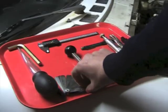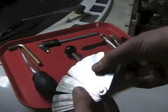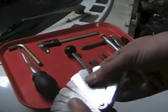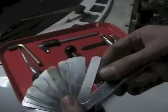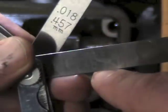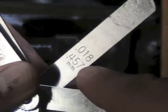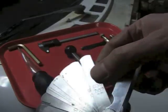Here's a very important tool — a measuring device known as a set of feeler gauges. These are a set of metal calibrated thickness shims that you're going to be able to slide in and check the distance between the camshaft lobe and the shim itself. The very best ones are calibrated both in English and in metric. They come as a set, they're a little oily, but this is what you're going to need to check that gap.